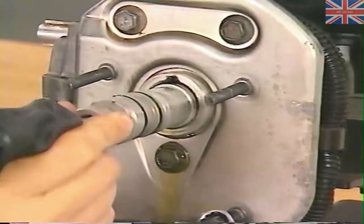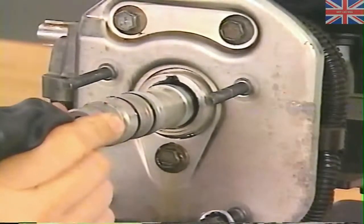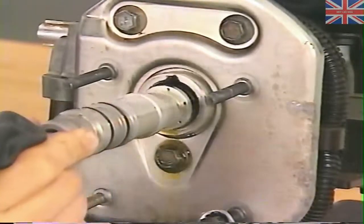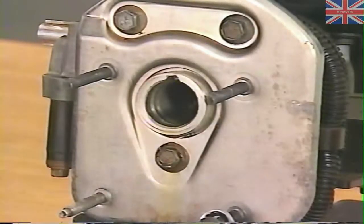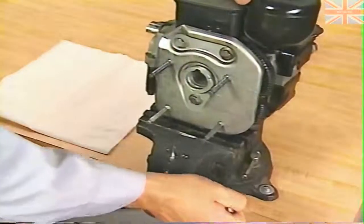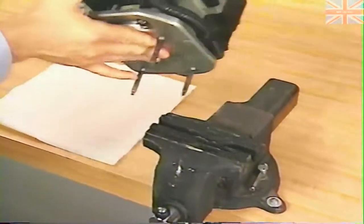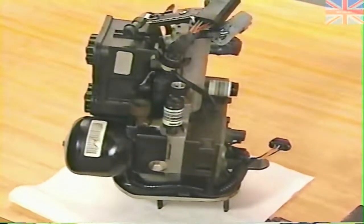Remove the primary piston assembly by pulling slowly and keeping it as straight as possible. If the piston assembly should catch, try sliding it back into the bore a short distance, then pulling it out straight. Do not try to force the piston assembly out. Once the primary piston assembly is removed, release the hydraulic assembly from the vise and place it on the bench on a lint-free cloth, stud side down.